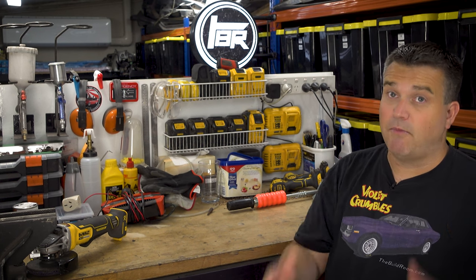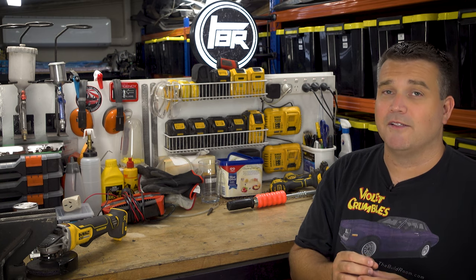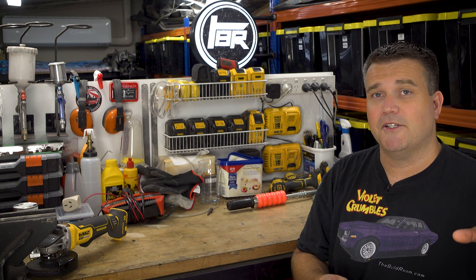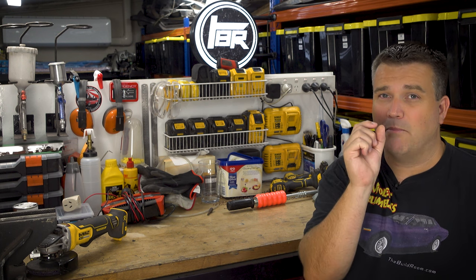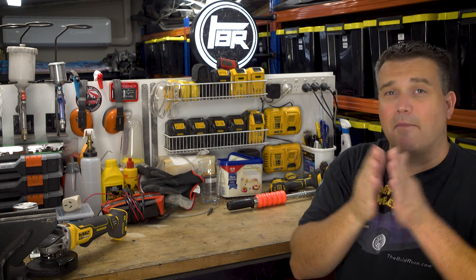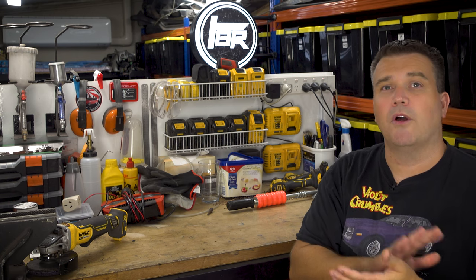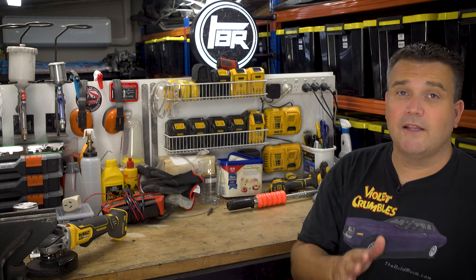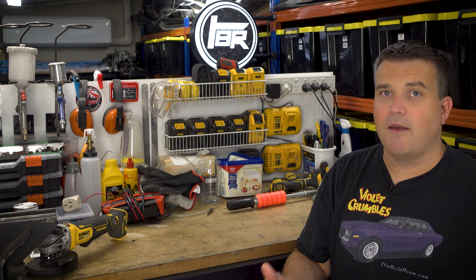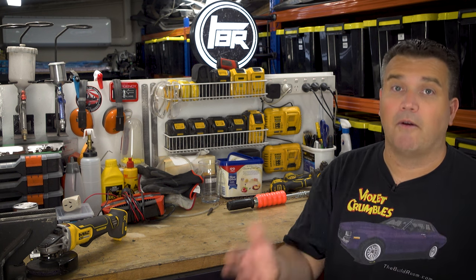In terms of the spot welding and dent pulling, that was excellent. You'll see in some of those images, I got the points at which I was pulling to a millimeter or 2 millimeters apart from each other. So it gave me an incredible amount of control. I was able to pull those panels back to flat relatively easily. It did take some time, I've spent some hours just tapping away at that thing, but I think it was thoroughly worth it in the end.